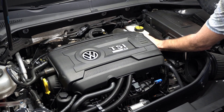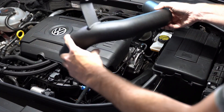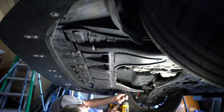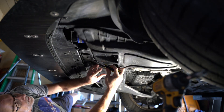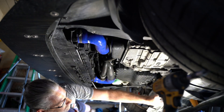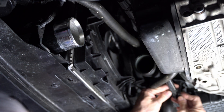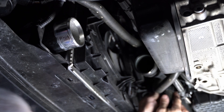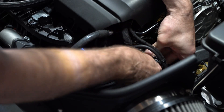I'm going to do this entire thing with the battery and battery tray in. So I'm just removing my intake pipe. The EQT pipe doesn't seem like it's going to go anywhere, and that's because it's not a one-for-one. You also need to get underneath the vehicle, pull off the existing pipes to the intercooler, and relieve some of the clips and connections to cabling. There's a screw down here holding the factory charge pipe to the bottom of the block, and another one at the top of the block, plus some additional cabling you'll need to break free.